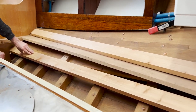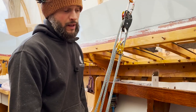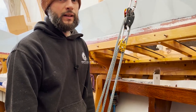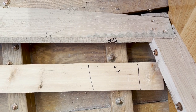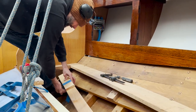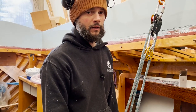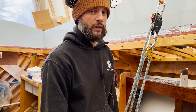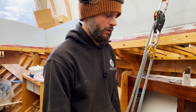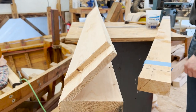So then I took a 1.5-inch board and put it in there. That means on the forward end, I need an extra inch to pad it out to 1.5 inches. And in the back, I need an extra 1/2 inch. I can install those and then pick up the distances to the rest of the frames and make custom pads for each of those. That'll give me a straight line supported on the frames, and that should support the back of the tank.